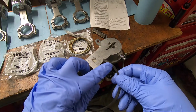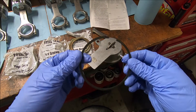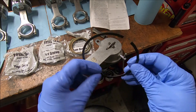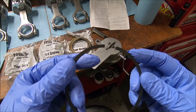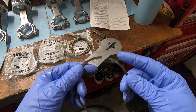On these rings, the part number is going to be up. They have a little beveled edge on the inside, and on the second ring that bevel is going to be pointing down — so it's on the bottom side. The easiest way to remember is that if it's got a dot or a part number, most of the time that's going to be in the up position.